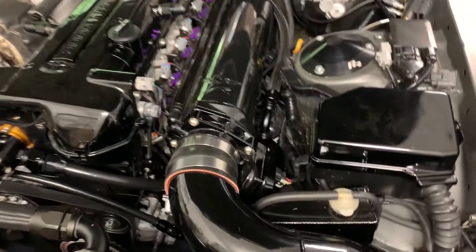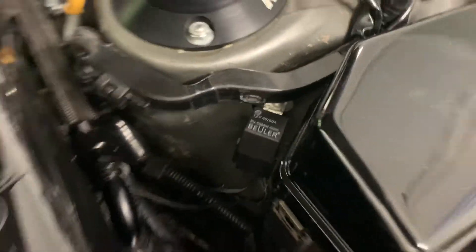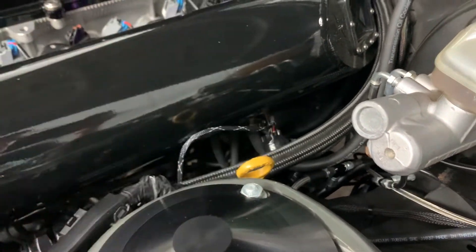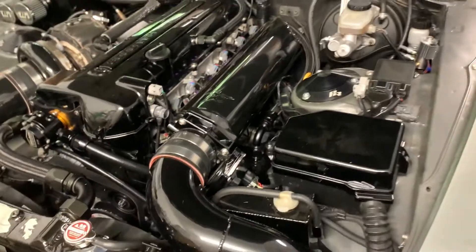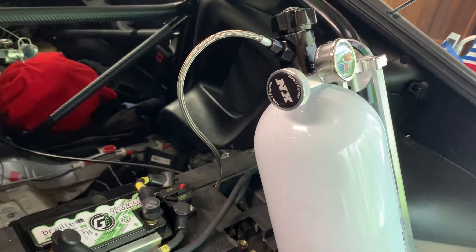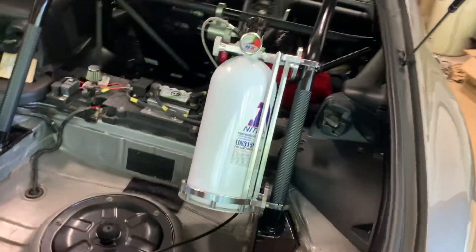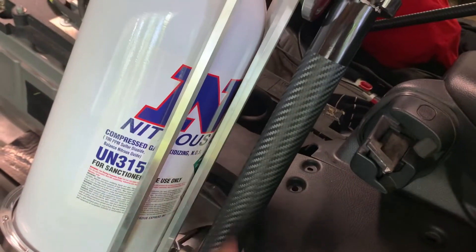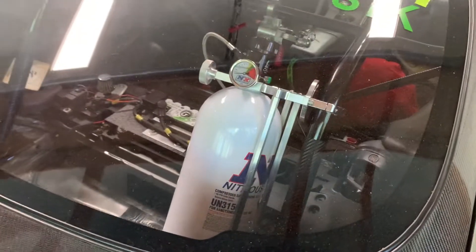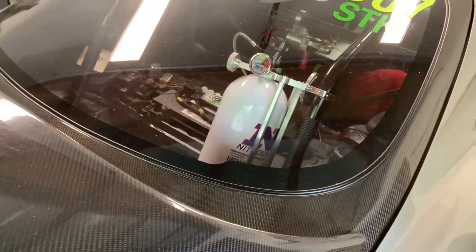So I had another chance today to work on the car a little bit more, and the nitrous kit's pretty much done. We have the relay mounted right there, the solenoid is over there, nitrous going in on the charge pipe, all the wiring's ran. I have the trigger running through one of the OEM connectors here, so I just have to repin it at the ECU and then set up the activation and arming switch. The nitrous line is going under the car through the PHR fuel brackets — there's a spare area there, comes out right there. The bottle is nicely mounted to the cage. I just didn't want to mess up the paint too much, so that helps a little bit down there. The bottle turned out pretty sweet, clears the hatch nicely. You can see the pressure right there. Nitrous is pretty much wrapped up.